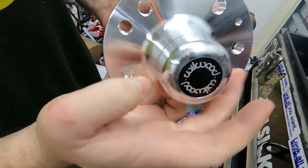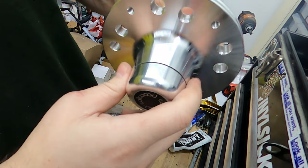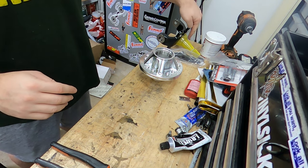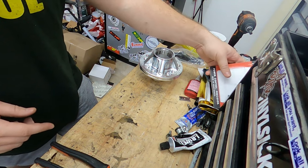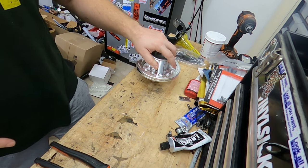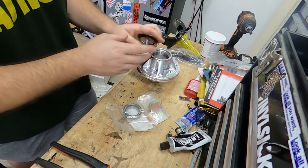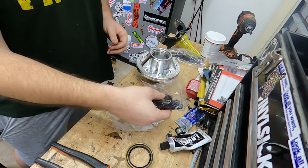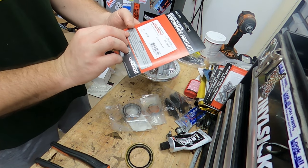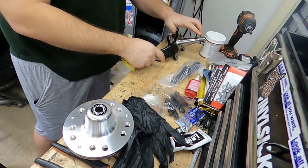This little piece is a nice screw-on cap — I love that. You don't have to go beating on it like the other ones, because the other ones you have to tap on with a hammer or wrench. They all get dented and they look ugly. We need to get this put on here. These hold your rotor to the hub because they go into these small holes. This is our outer bearing and there's an inner bearing. The seal goes here after you grease the thing. Then of course we have our steel studs, this is to assemble the 2-inch rotors, and here's your lock nut for the hub on the spindle.